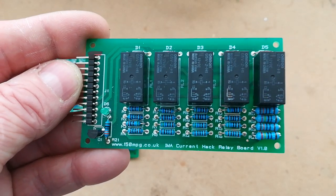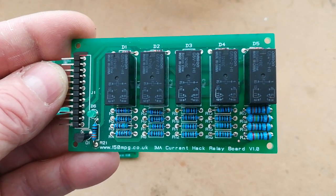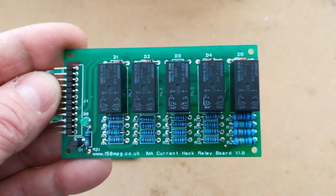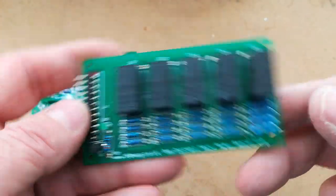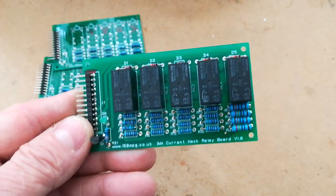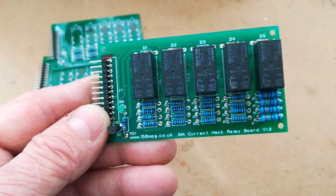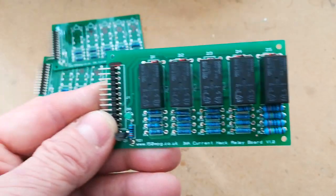So if the car is pushing 100 amps and then we engage the plus 50% module, the car only sees 50 amps. And if it wants to increase that back to 100, it has to add 100% of 50 back onto 50. So the naming is a little bit confusing. Is this plus 50 or plus 100? Anyway, as you can see what the issue is. You might actually call this a switchable plus 40 and plus 100% board, because it offers the plus 40% option with the 1K resistors, and then with the much lower value resistors, the system only detects 50% of its actual current, and therefore has to double the current to achieve what it was trying to achieve before. So you could say that's plus 100%.